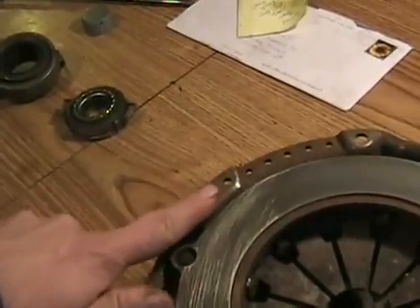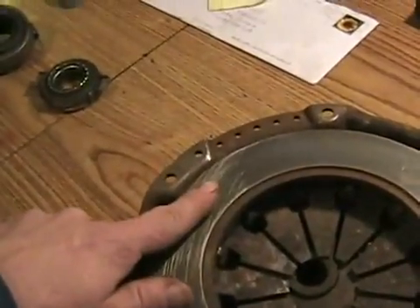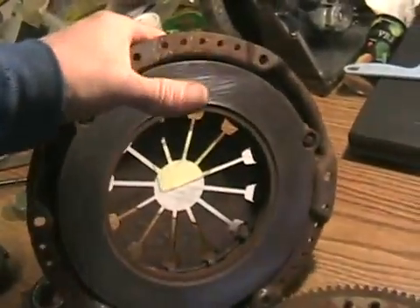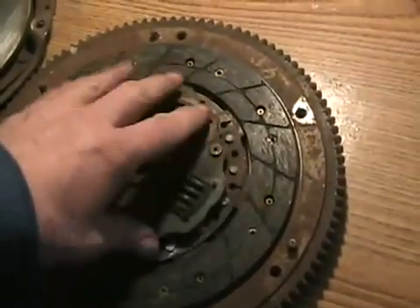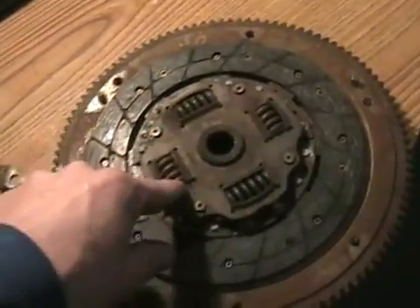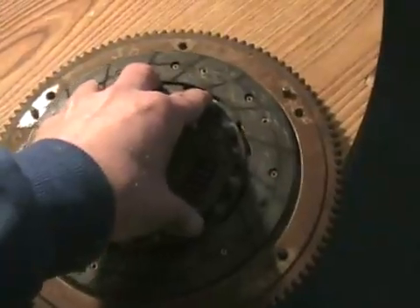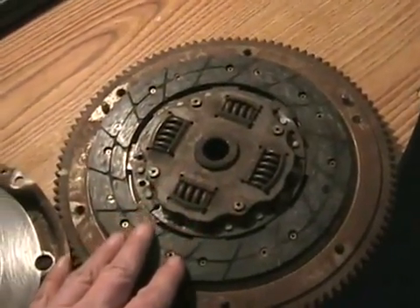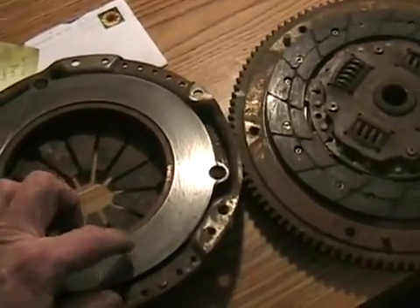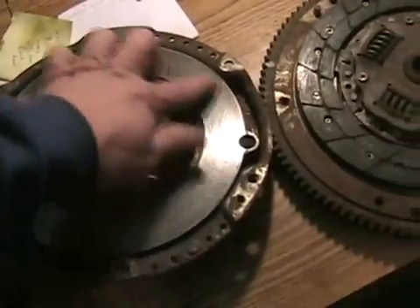Right now the drive plate is almost level with the mounting surface, but when the clutch is fully depressed and those fingers are moved, the pressure plate can move almost a quarter inch. When it moves back, it stops squeezing the friction disk between the two shiny surfaces. The four small damper springs prevent chatter — that jumping and vibrating when you're starting to engage the clutch — which causes uneven wear. If you get the pressure plate rebuilt, they regrind the surface.